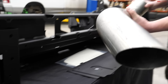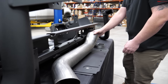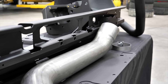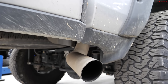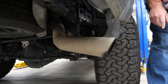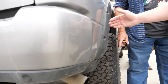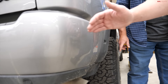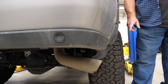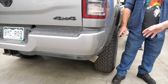This is a new component for the exhaust. When you put the AEV rear bumper on your vehicle, the lowest point becomes your factory exhaust, which hangs right below the corner tube. So what they do is remove the very end of the exhaust and move it back and up — so now the lowest point you'll hit off-road won't be your exhaust, it'll be that steel corner instead.